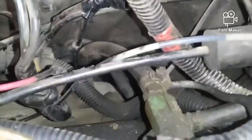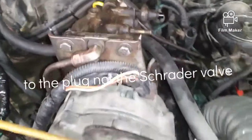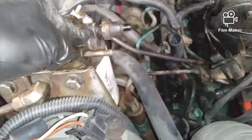That's correct. However, per manufacturer, you are supposed to have a T, which is going to be this guy that's capped, and he is to return. Any of them, they all do the same thing. It's all going to be equal pressure. The return line, you can really tap off anywhere. He is to go back to this guy for 2 reasons. One, since my return line is blocked, my pump down below has to work harder now because it's pushing all that fuel back to the fuel tank instead of recirculating it to go back up to here for recirculation. This is a no-no to be capped.